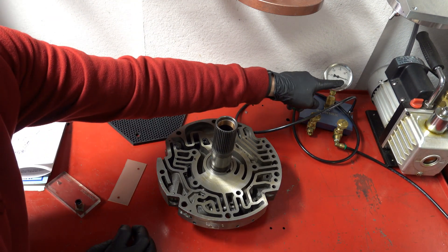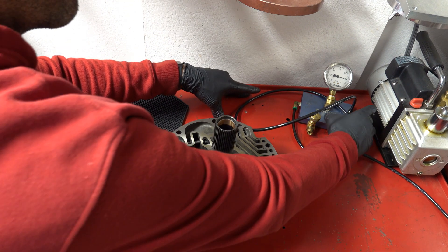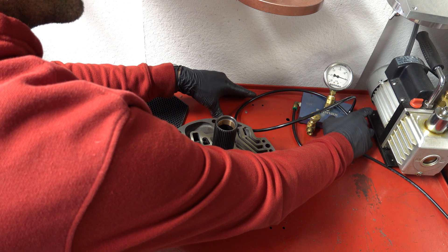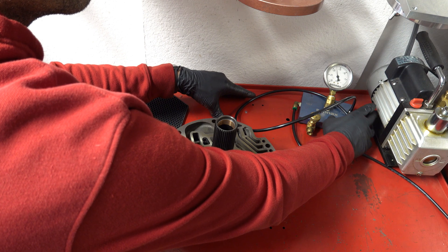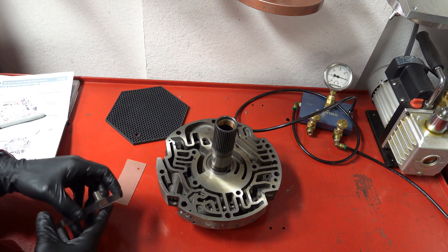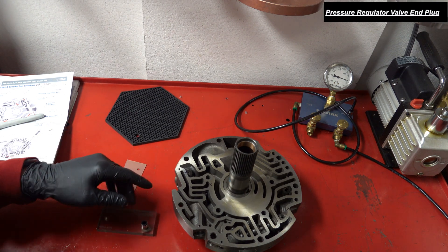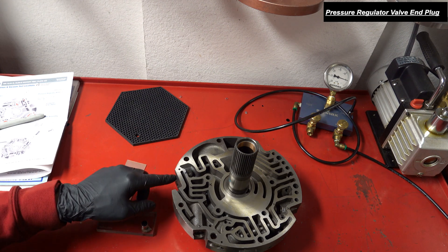I already did this — it's reading right at five inches. When I put my finger on the calibration port it's now 25 inches; take the finger away and it's back to five inches. 25 and five, so we know we're ready to go. Taking the hose out of the calibration receptacle, we're going to stick it right here. What we want to see is 15 inches of lift or more in this location — we're testing the inboard side.